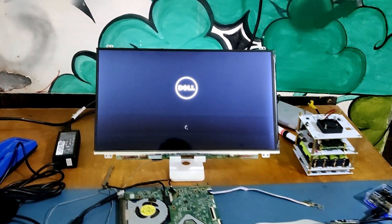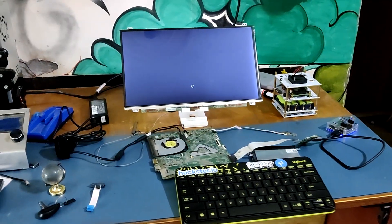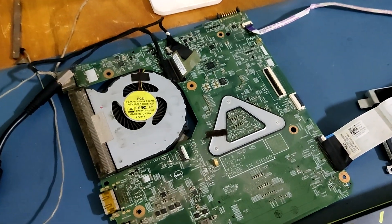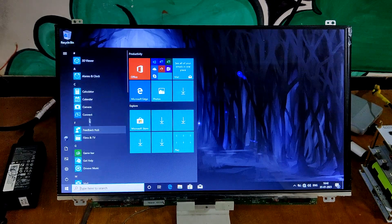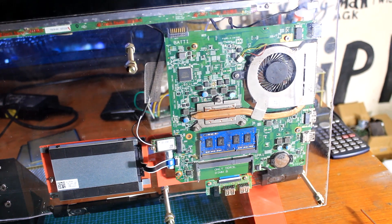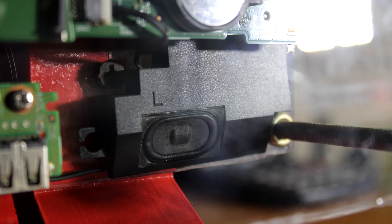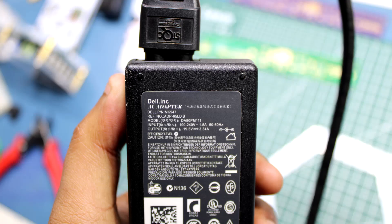Before beginning the build process, I first connected all the laptop components including the display cable, power switch, FPC cable, hard disk drive, and Wi-Fi adapter and booted the machine. It used to run Windows 10 but it was corrupted, so I had to reinstall it. Before disassembling the entire system, make sure to verify that the OS is functioning. The motherboard is connected to the display and hard disk drive — the two essential parts needed to make this PC function. We will also use the IO board which has a built-in on/off switch, left and right speakers, a charging port, and USB 2.0 port. Since the laptop battery was also damaged, the system's primary power source is its charger.